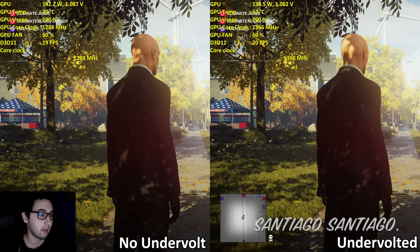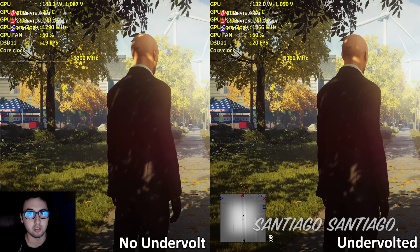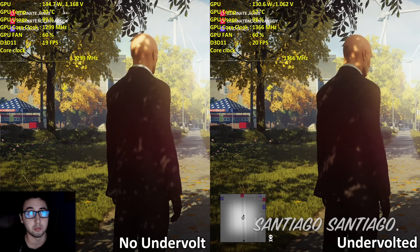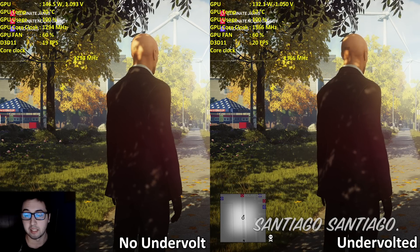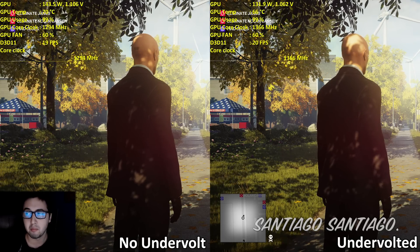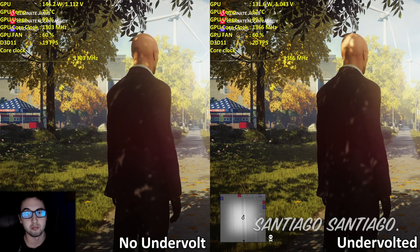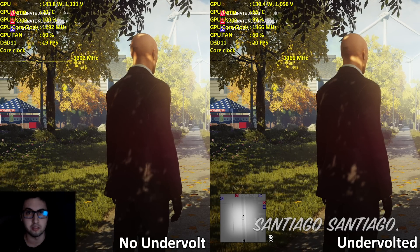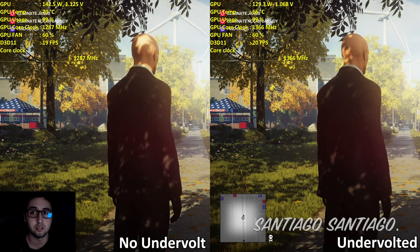That's pretty much the tutorial. I'll show a comparison with Hitman so you can see the differences with and without undervolting. You can even try overclocking a little after the undervolt — it might crash more easily because you're using less power, but you can try. I managed to get to 1400 MHz, a small boost from 1366 MHz, with 1000 mV in Wattman. Highly recommended for RX 570, 580, 590, Vega, 470, and 480 — it also made my core clock way more stable, holding a steady 1366 MHz instead of dropping to 1200 or 1300. It seems these cards are overvolted by default. Thanks for watching and see you next time.